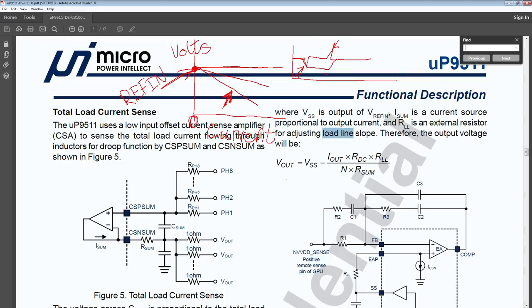In theory, setting up the load line very specifically on Pascal cards might actually be essential to your overclocking range on liquid nitrogen, because Pascal has a huge amount of built-in power gating technology. It does not have a constant current pull under load — your current draw is just all over the place, so your voltage under load just looks like an absolute horrendous mess. Which is why setting the load line properly would be really, really important.